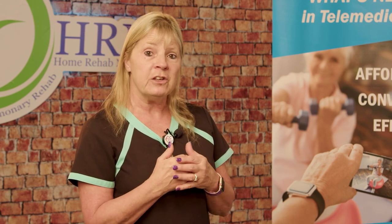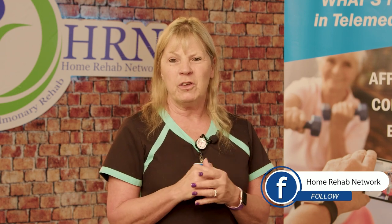Make sure you have a working smoke detector and fire extinguisher. Do not block or obstruct any of the vents. There are several different kinds of concentrators, but they all have vents or filters. Check and make sure the filter isn't dirty — they might have foam filters, spongy filters, or a filter you need a flathead screwdriver or butter knife to remove. Make sure you check and change those filters regularly so you're getting your therapy. Store the concentrator about 12 inches away from the wall so it can breathe and be ventilated. Never cover it with drapes, a blanket, or clothes. Keep it dusted off and make sure nothing is blocking or obstructing the flow.